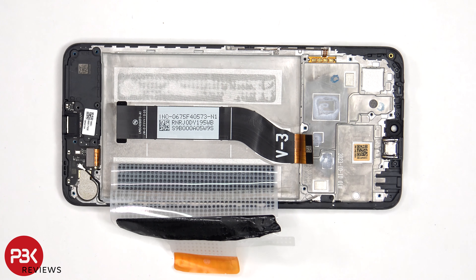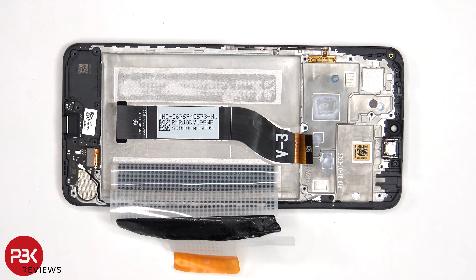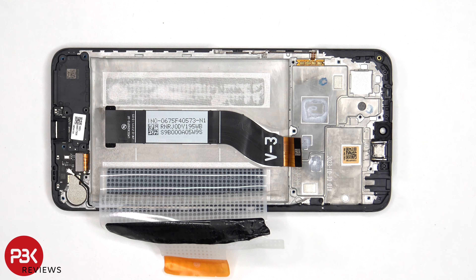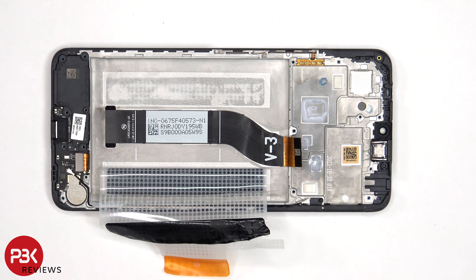Once the battery adhesive pouch has been peeled back, we can see the flex cable which connects the main board to the screen and the subboard. So if you need to replace the screen, you'd have to remove the back plate, the screws, and the back housing. You'd disconnect the battery cable from the main board as well as the screen cable and the flex cable on the bottom by the subboard. You'd pry the battery off, then heat up the front of the phone where the screen is to loosen the adhesive underneath, pry the whole screen off, apply new adhesive, reapply the new screen making sure you run the flex cables back to the openings in the midframe, and reassemble the phone.